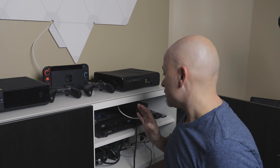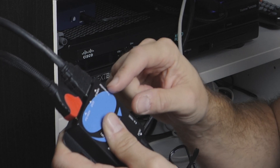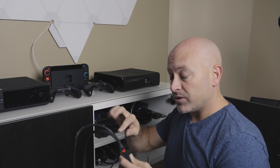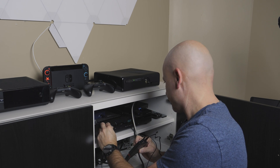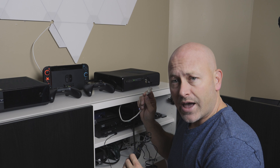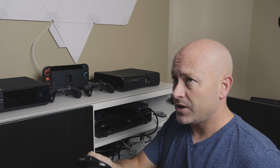Let's go ahead and get this hooked up and see if it works. I'm in the basement. I've got my cable box, game consoles, and things like that here. I've taken the cable from the cable box and plugged the HDMI cable into the HDMI input on the transmitter — the one with two HDMI ports. The second HDMI out I've plugged into another HDMI cable that goes directly to the local TV. On the other side, I have the IR output, which I'm going to stick right to the front of the cable box, and I have my 5-volt power supply. I'm going to plug in the end of the CAT5 cable I've run to the TV upstairs. With all that plugged in, I take my cable box remote, turn on the TV and cable box — and sure enough, we now have TV in the basement. Let's head upstairs and see what's working there.